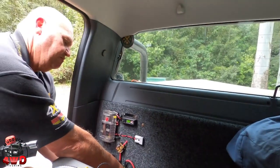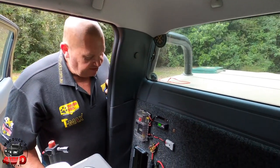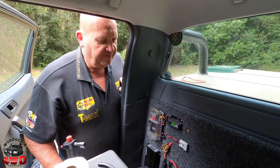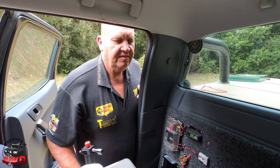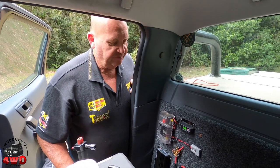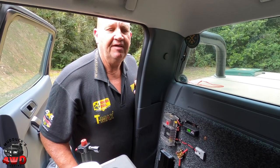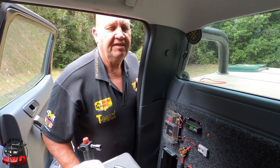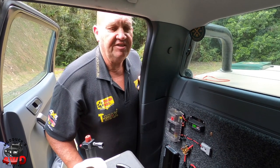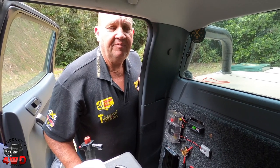Anyway, it'll go eventually. So what do you believe is going on? Well, I think my DC-DC charger is taking power from the start battery for too long. So I'm disconnecting the blue ignition trigger wire from the main straight 12 volt DC source. For the time being, I'll find an ignition source for it later. On other cars, it hasn't been a problem. They shut off the batteries quick enough, but obviously these Rangers are a bit DC sensitive and it's flattened the battery too much by being connected that way.